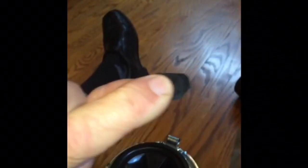Since it's unplugged, it's safe — you can reach in and pull out the little plastic plug. This is what it looks like; just throw that away. That's why the dishwasher won't drain. Thanks so much for watching, and please subscribe to our channel!